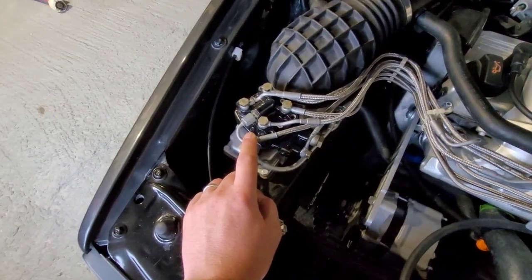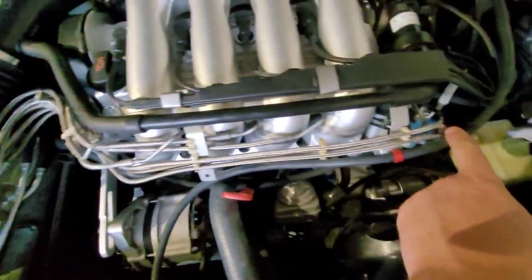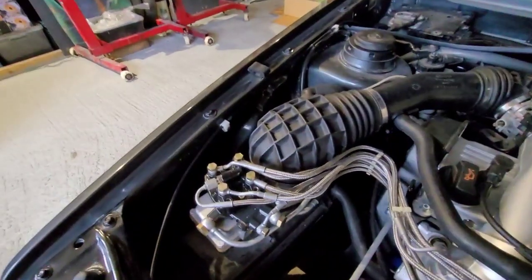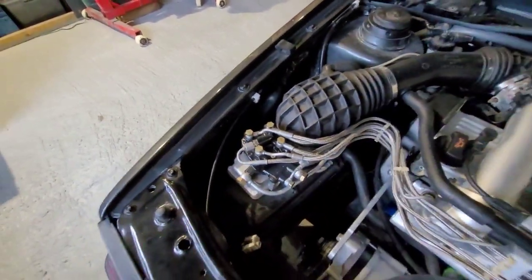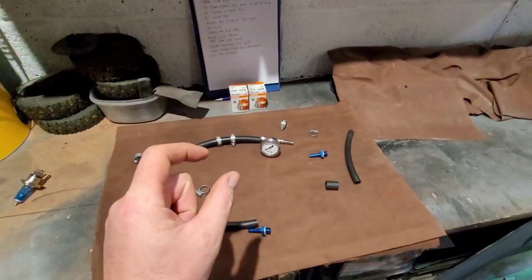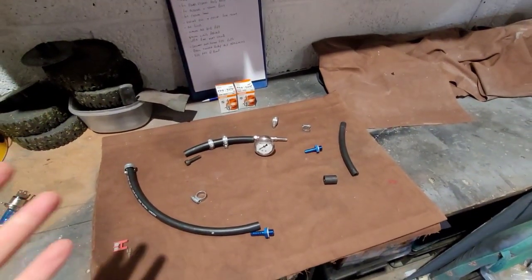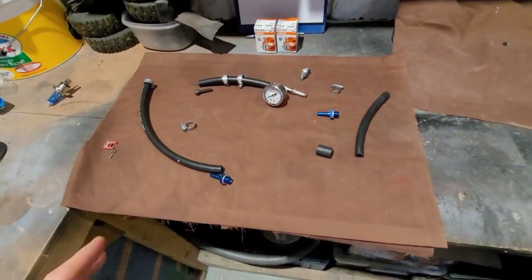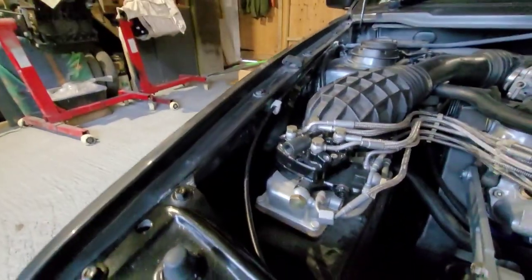Because this will be empty — there's no fuel in it — I can take that line off and leave it empty. Fuel comes out of here all the way down into one side and back out as a return, but as there's no fuel pressure going there we can leave it out. Cost-wise, all these bits including the tap — a tiny little same-thread tap — was 54 quid delivered. All available on eBay, cheap as chips, readily available. You don't need to spend loads of money.